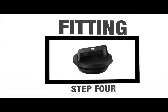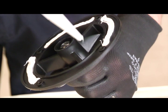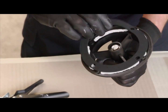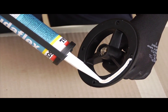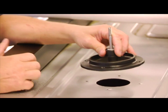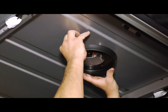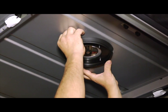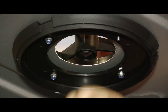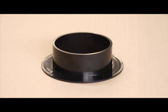Fitting Step 4. Fit the foam gasket to the base of the rotor using a good quality waterproof sealant to hold it in place. You can also add sealant to the side of the foam gasket that will make contact with the roof when fitted to the outside of the vehicle roof. Place the rotor base on the roof and push the four bolts down through the fixing holes. You'll need the assistance of a second person at this stage. From the inside of the vehicle, offer up the support ring to the underside of the roof, passing the four bolts through the four holes in the support ring. Whilst the person on the outside uses a slot-headed screwdriver to prevent the bolts from rotating, the second person should fit and tighten the nuts provided. Do not over-tighten at this stage.